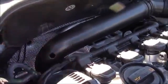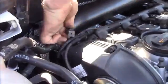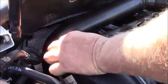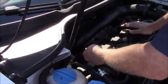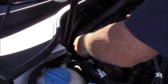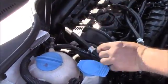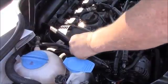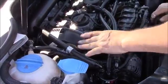You are going to need a 3/8 NPT tap. Just run it in slightly so you can start some threads, so the barb that we put on here. Okay, now that we've got our barb installed, we're simply going to put hose that we've also measured the length, hook it up to our one-way check valve, again flowing away from the can. Both the outlets flow away.